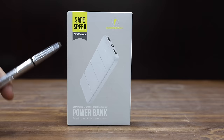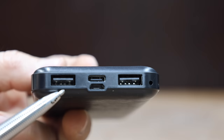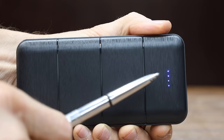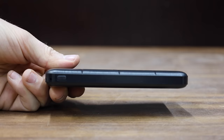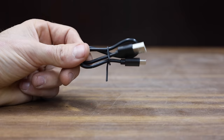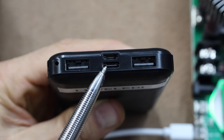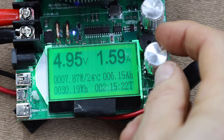At a very reasonable price of only $16 is the Loveletti brand — a 15,000 milliamp hour dual USB power bank that claims to offer fast charging capability and compatibility with all smartphones and USB devices. It uses a high-density lithium polymer battery and is made in China, weighing 215 grams. The Type-C on the Loveletti is only for charging the power bank. Testing the left-side USB-A port, the Loveletti is performing the best yet, holding steady at 13.29 watts, moving into the lead over the Miotti.